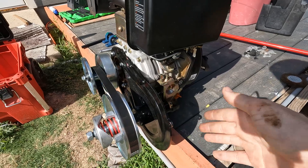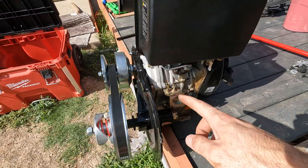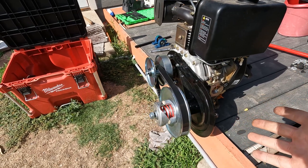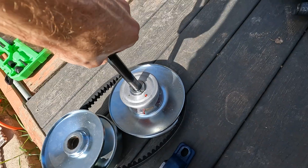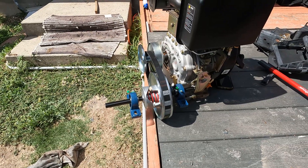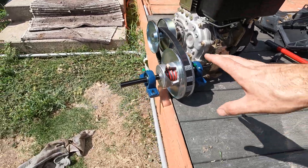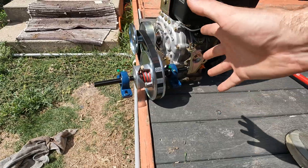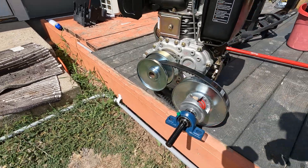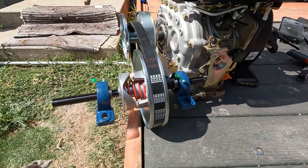Let's say your backing plate just isn't going to work out — you need another mounting scheme, or you don't like the fact that it presses on the throttle, or your engine is a little different. I'm going to show you a second way to set up your torque converter for the same result, and it gives you more flexibility on how to mount it in your go-kart or minibike. All you have to do is buy a three quarter inch jackshaft and three quarter inch pillow block, and you can set this up however you want — set the clearance, mix and match — as long as the pulleys are lined up and correctly spaced. I'm not sure which method I'll use when mounting it in the go-kart, but I wanted to show this because some people were saying they were having clearance issues.